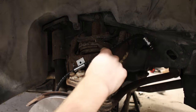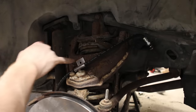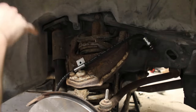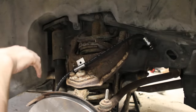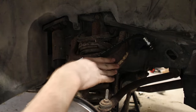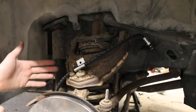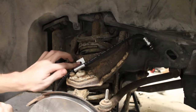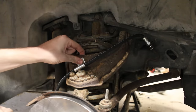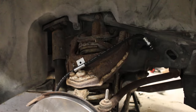The rubber brake line is now connected to the hard line, and the only thing to do now is to rivet it back onto the control arm to be secured in place. However, I'm not going to do that right now — I do plan to take apart the whole suspension, the control arms and everything, and repaint them along with getting new bushings and ball joints. So because of the painting, I'm not going to bolt it down now. I'll probably zip tie it just to keep it secure temporarily, and after I do all that stuff, I'll put it in its final spot with a rivet.